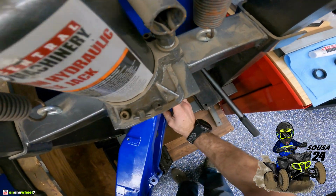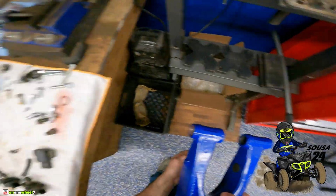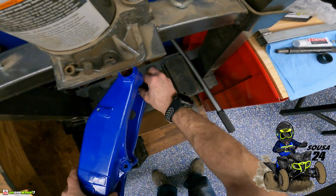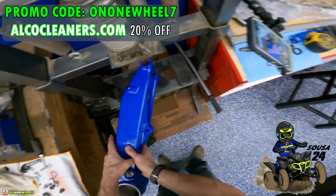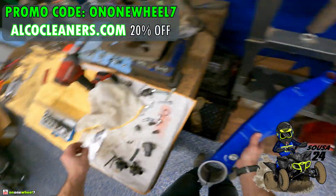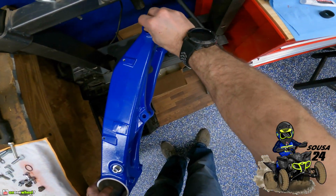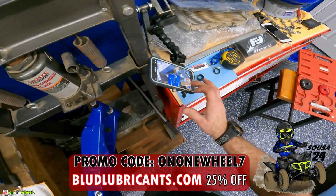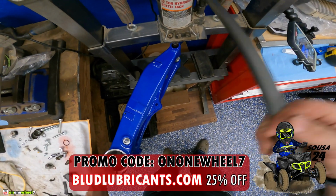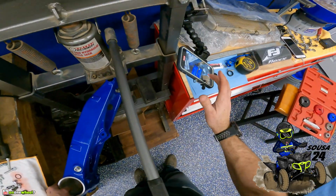And then we've got grease all over this thing. I'm gonna get that guy out. And then we can throw our seal in there. All right, so this one we can use a larger tool for the seal. Push it down. Use our same little extension here, and then do this again. Push this down till it's flush. This will go in very easy, obviously. That's good right there.